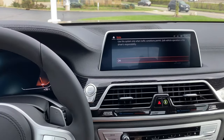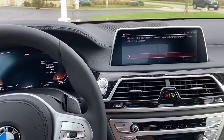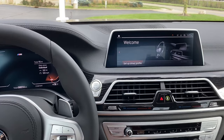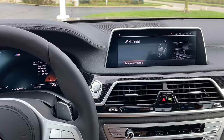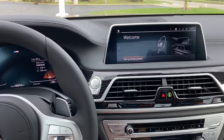After that 30 seconds is up, click the volume button again to turn the iDrive system back on, and that should complete your system reboot. The main purpose of this reboot is if you're having troubles or issues with the software — if certain apps aren't loading, or if you're having issues with Android Auto, Apple CarPlay, or anything related to the operating system in the car.